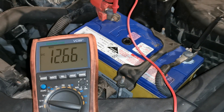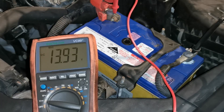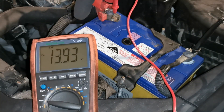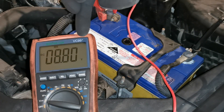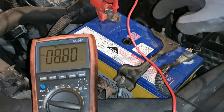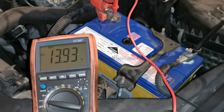Let's crank it over now. After cranking, I have it switched off. We can see the maximum when the alternator kicks in, then clicking back we get a minimum of 8.8 volts - just after one start. This is showing that this battery is getting weak. You could hear it in the sound as well. I'm going to do that test one more time to see what it comes up with.